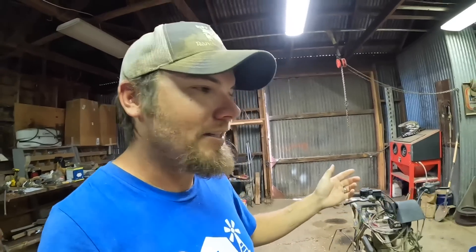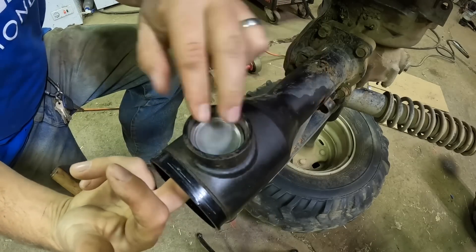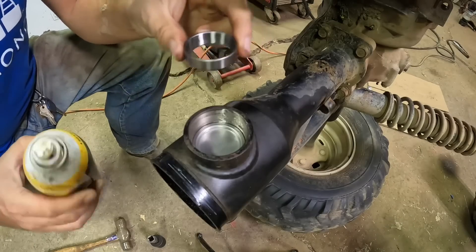I've been filming this reassembly over the last days, maybe weeks at this point. In the last clip it would have been me putting the lower case back on the engine with the new stator installed. Now that's all bolted up, the next step is reassembling the swing arm and bearings and putting that back on. After that we'll just put everything back together — clean the carburetor, put the gas tank back on and the battery. Before I put all the plastics back on, we'll try to start it and see if we're making any progress. To keep your grease in place, you put these caps in here.